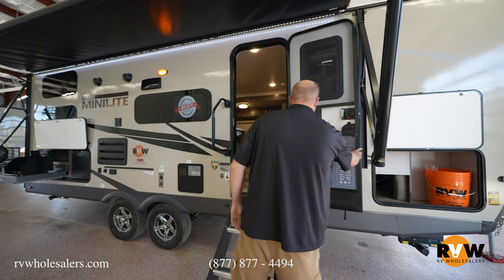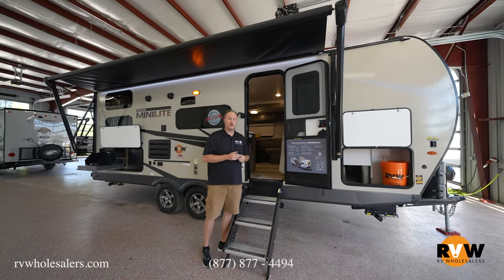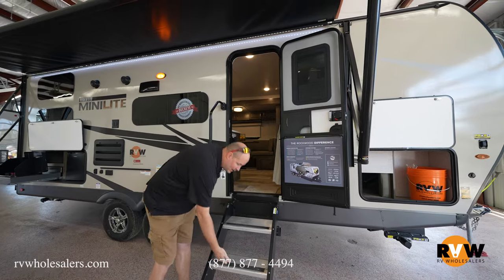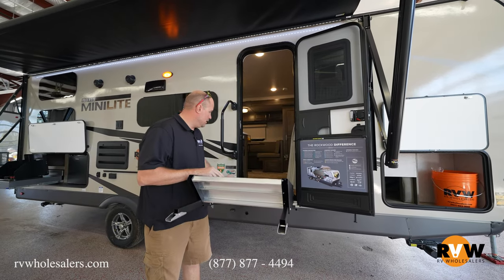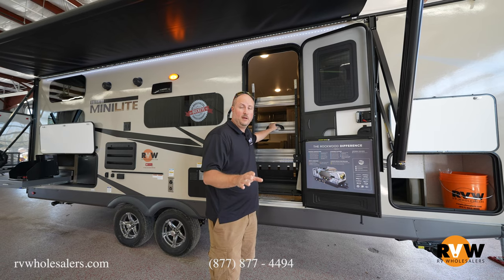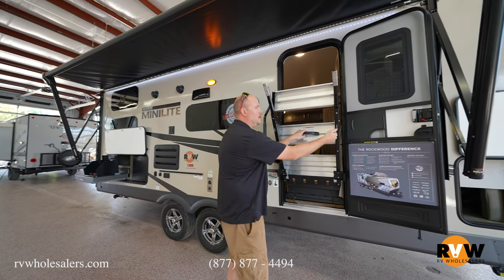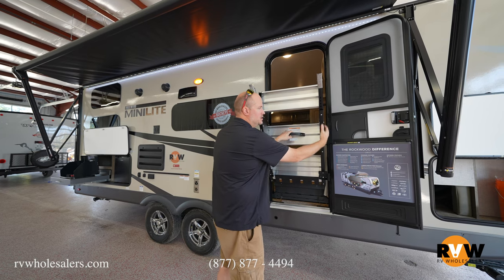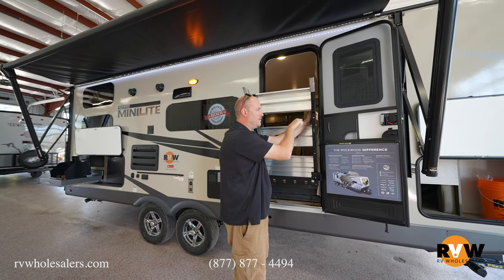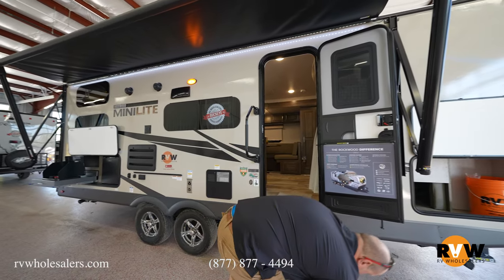One thing a lot of people don't realize is a really nice feature: these steps. A lot of RV manufacturers give you solid steps but they're heavy. You'll notice I can pick this up with one finger — there's a strut on the inside of this door that allows it to go right up, and they give you a nice handle. That's really been nice for customers because it's very easy to put in and out. On the steps they also have push adjusters — the old ones you had to try to line up a pin every time, but now you just push it here to adjust out and bring the legs out without lining up a pin every time. That's one big plus they've changed on their steps.